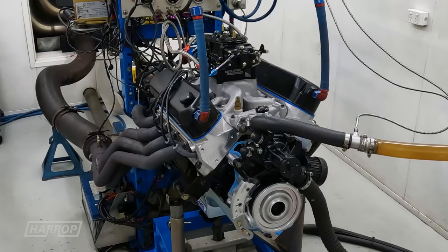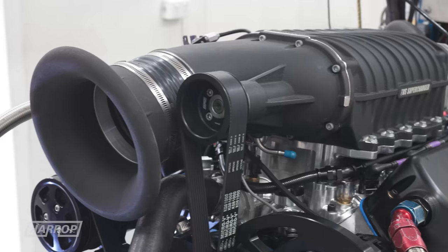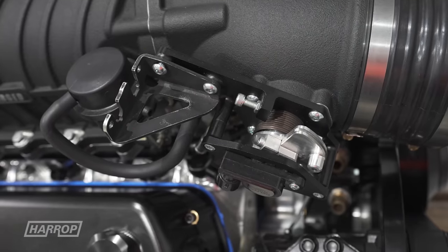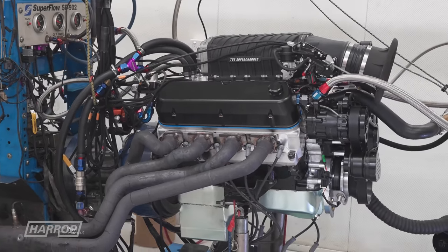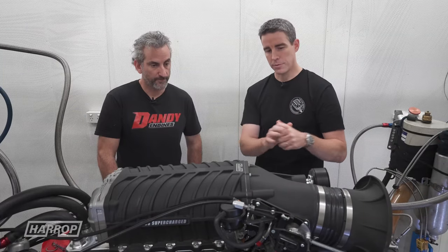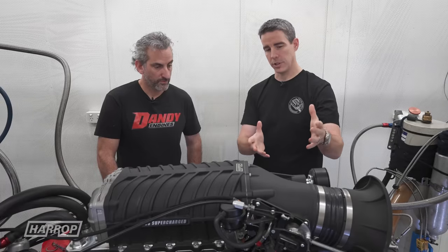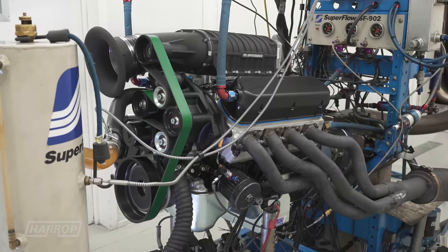After running it aspirated we put the supercharger on — it's EFI. This particular 2650 is running the optional 110mm front cover with a 110mm throttle plate and cable actuation, though we do offer drive-by-wire as well. Special mention to FuelTech who are looking after the engine control; it runs a cam sync. We have two drive options: an integrated drive with power steering and AC integrated, and a heavy-duty drive — we ran the engine on both to compare performance.